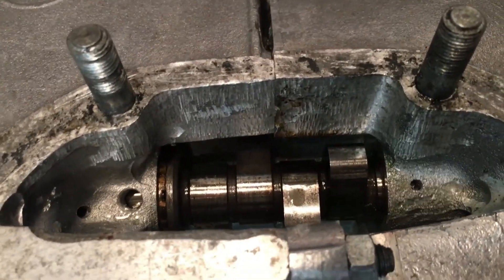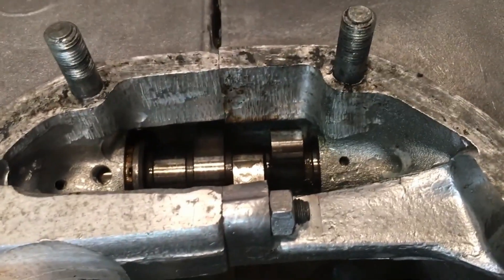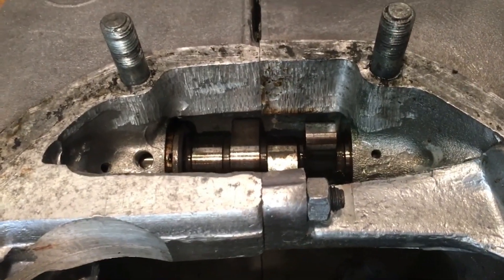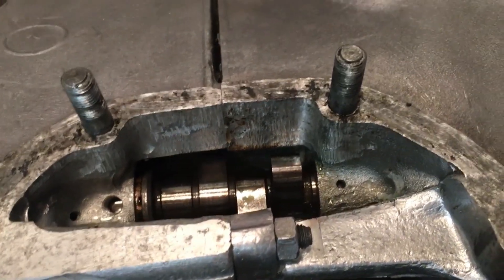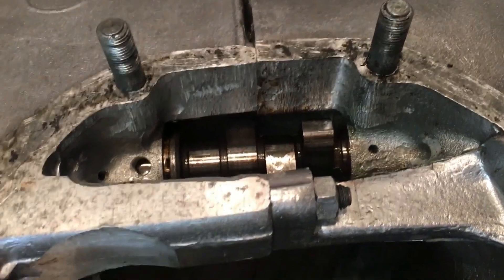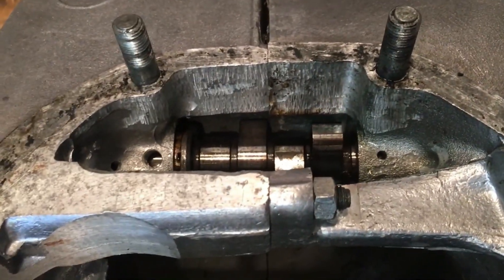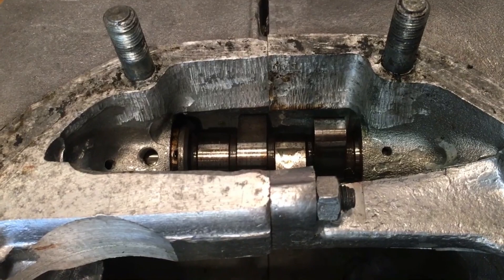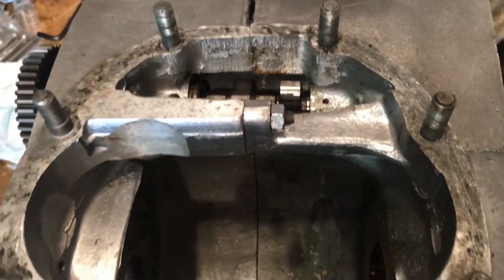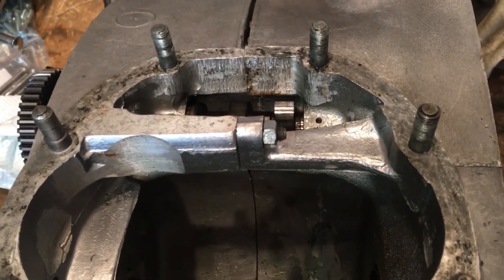So that definitely does make a difference. And I think it will also improve it once we get the barrels on and pull this lot together. In some ways there's an argument to be said that if you can get certain crankcase half bolts and nuts with the barrels on, then there's a better method of trying to line everything up if you're tightening down the barrels at the same time as tightening up the cases.